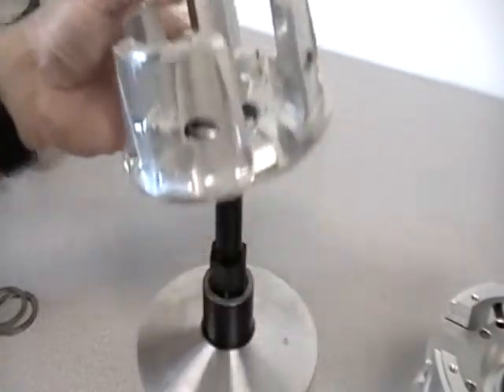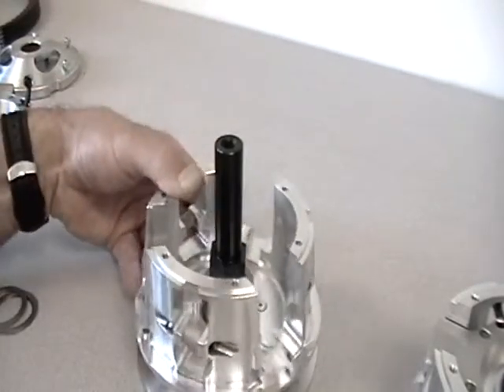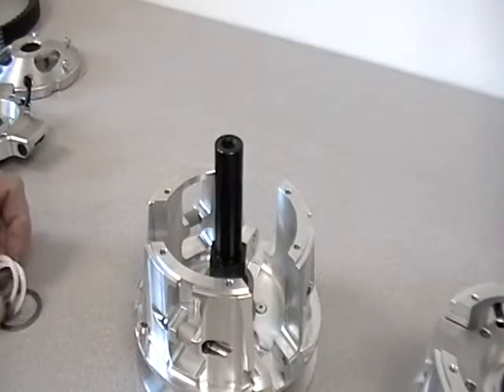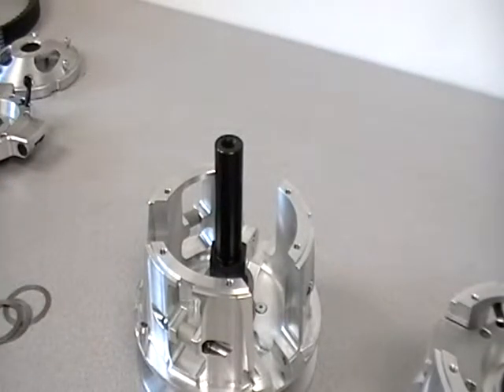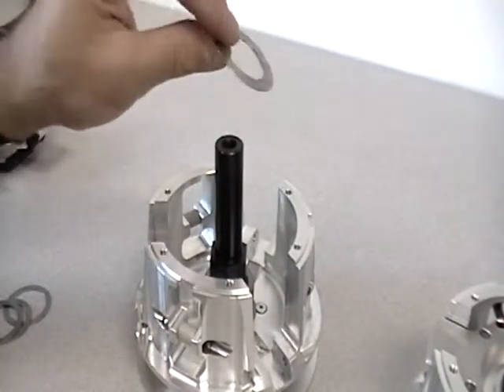The belt shims are just a little bit smaller than the main shaft that this movable sheave slides up and down on, and the movable sheave has to slide over those washers. That controls your belt clearance. Don't get confused over spider washers, which are larger diameter — they have nothing to do with belt clearance.